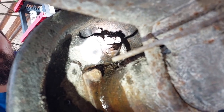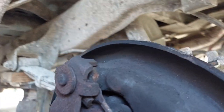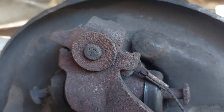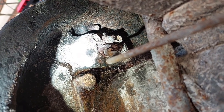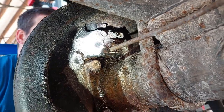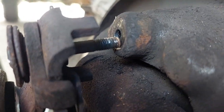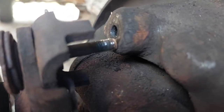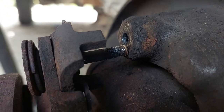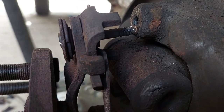We're going to remove the parking brake lever. Essentially it's disassembly up at the top — there is a nut that needs to get out of the way so I can get to the wheel cylinder. It's right up there in the backing plate; I think it's a 7/16ths, and you're definitely going to need a socket. We did get it out but it kind of rust-welded — the threads got banged up, so we had to take a screwdriver and put a lot of pressure on it. I'm going to do more detailed filming of where all the springs go as we put it back together.